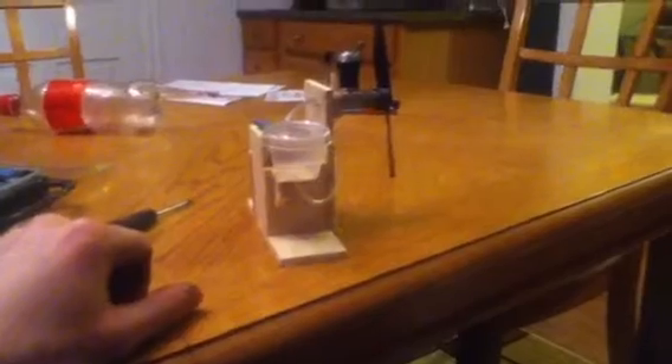It's got a spring-assist start — you rotate it the opposite direction and it pushes that way. You wind it up maybe once or twice. I have it just taped up here; maybe I can get a little holder. I epoxied together a little dish — it says 'Dart' on it — it's a little container I fill up with fuel, roughly the size of a normal Cox fuel tank. There's some weed whacker fuel line, and it works with nitro too. I also found out the nitro fuel line works with gas as well.